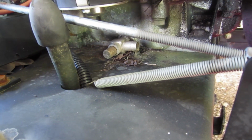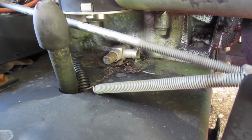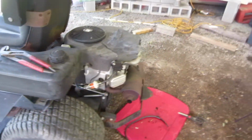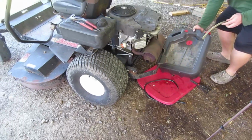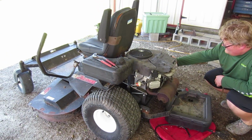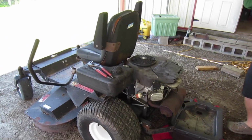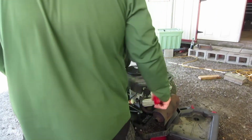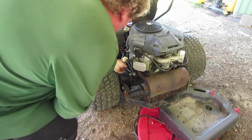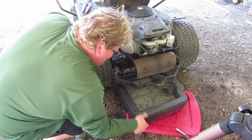that's an awesome place for an oil drain. It looks like it may have a tiny bit of water in it. So good thing we're changing it. I think I see a tiny bit of water or something coming out of it. It could be fuel, but that's not surprising seeing as how long this thing sat outside. Is it coming out of the oil drain? You see it? Well, that's just oil. That could just be crankcase condensation, too. Yeah, the oil does need to be changed.